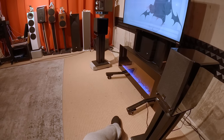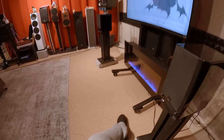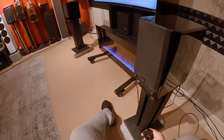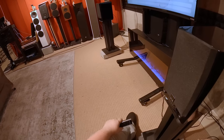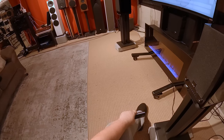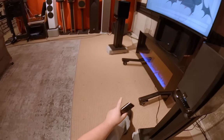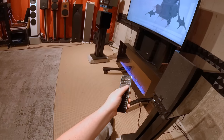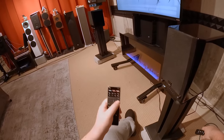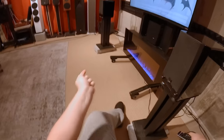There's a delay issue common to most powered speakers — they go to sleep when idle, then wake up when they get a signal. It's about five seconds to wake, which sounds quick, but I think they sleep too soon. If it's 10 to 15 minutes, that's about the time it takes to pause something, go to the kitchen, pop popcorn, take a leak, come back and unpause — and then there's five seconds of no sound while the speakers wake up, and you have to back up 10 seconds.